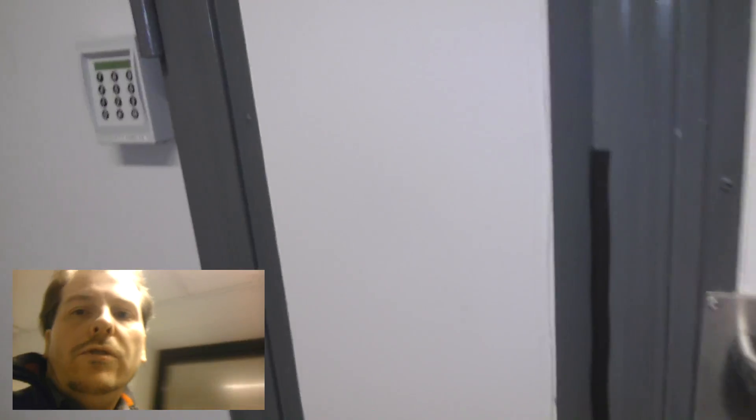Hi and welcome to my playhouse. Today I'm at work again and I've just upgraded another HP DL580 generation 8 from 1 to 2 terabytes of RAM. I have another little server that needs upgrading — one of our SQL servers. Those run on the DL380, and right now they have 512 gigabytes of RAM. It's being upgraded to the maximum, which is 768 gigabytes of RAM.